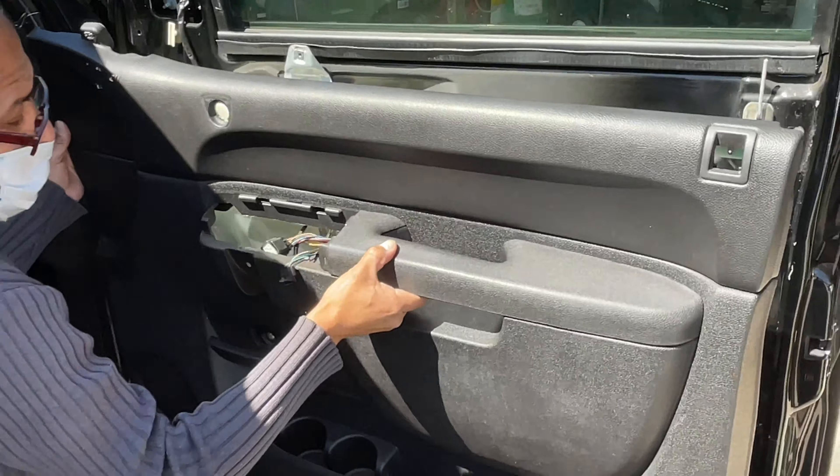That's how you remove that. Now this right here is going to have a little square — just pull it up, take that little square out. Once those screws are removed, start from the sides and pull it out so the door panel gets unclipped. Once you pry everything out, the door panel is going to come off just like that.